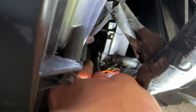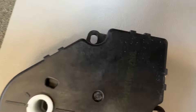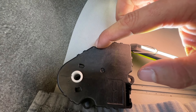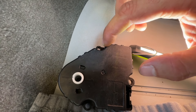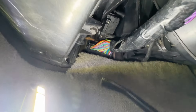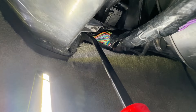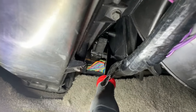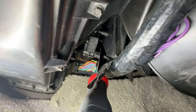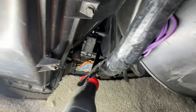Now we've got to figure out how to get the one up top. I just snuck my ratchet in — you've got to kind of do this one by feel. There's a little cutout up top. I slid my ratchet over until I felt it go into this little cavity, then just pushed it in and started turning it. It's coming loose up there, but then the ratchet stops loosening the fastener, so I'm going to put pressure on that top fastener with a pry bar and hopefully spin it the rest of the way off.